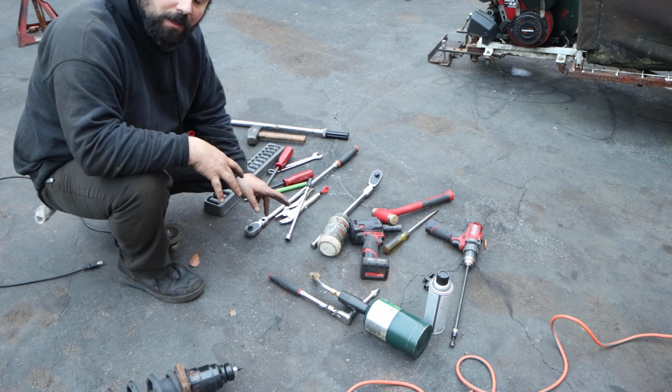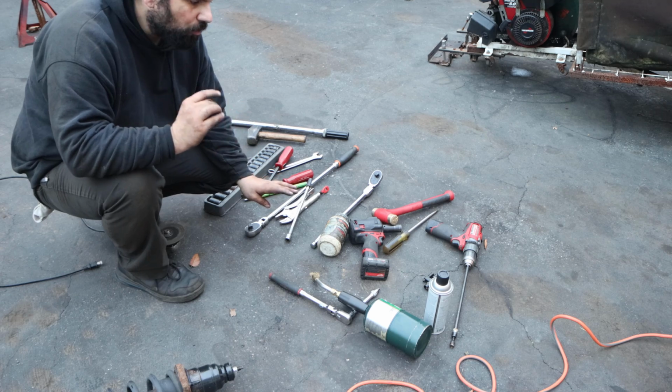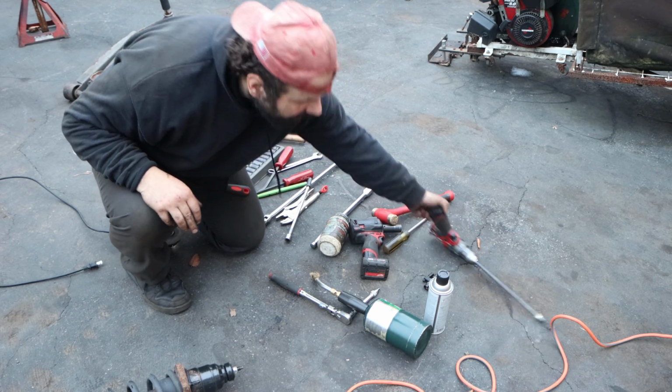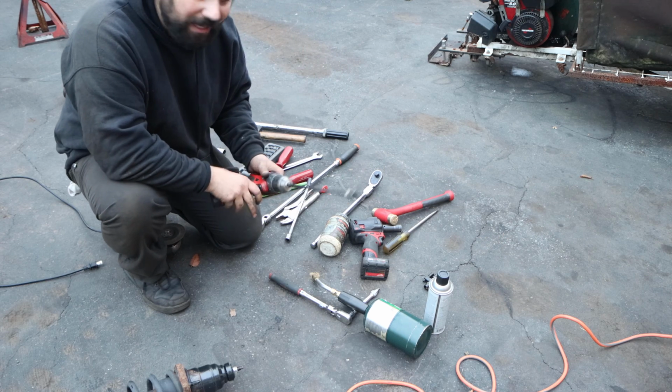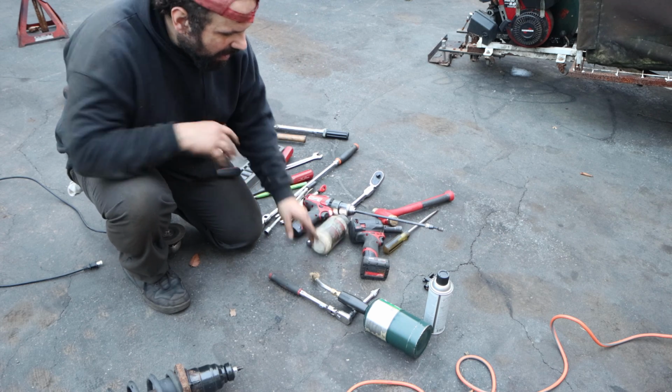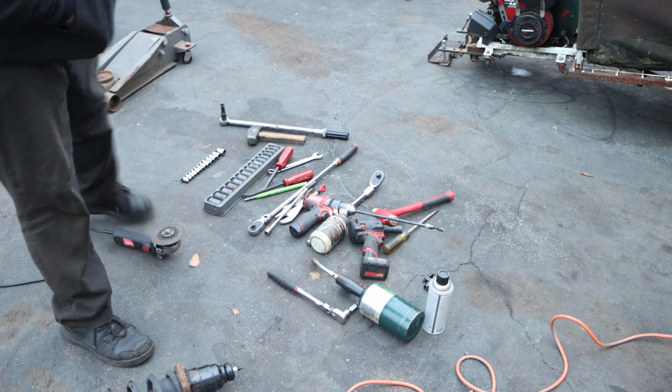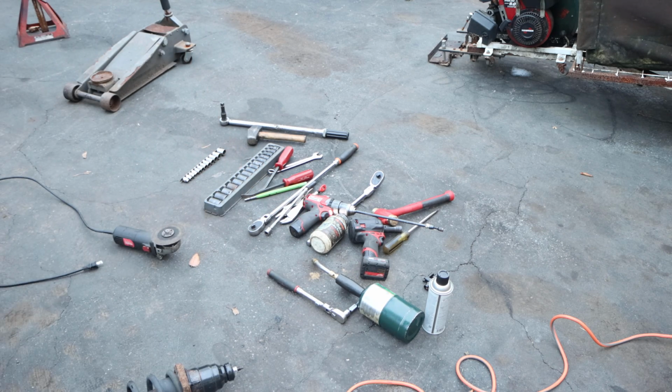If they snap, it's okay. You use self-tapping screws. Now, a self-tapping screw was already in there, so that was 5/16. So that's this right here. I did bring some heat, thinking that the heat would save one of these bolts. That was not the case. It snapped anyway. I got that thing cherry red.